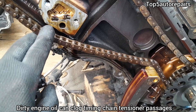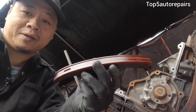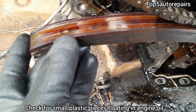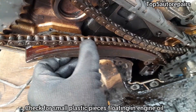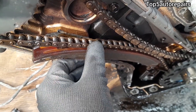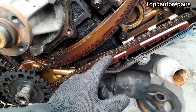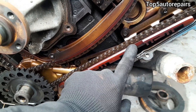The next reason why your timing chain is making noise is going to be caused by a bad timing guide. When the timing guide's surface becomes extremely worn or a part breaks off, the timing chain will not smoothly glide on the timing guide — causing clattering and rattling noise at almost all speeds. The timing guide is a very good wear indicator; if there's too much slack between the timing guide and timing chain, the timing guide should be replaced.